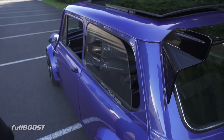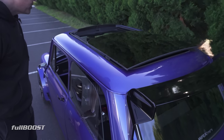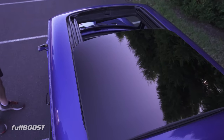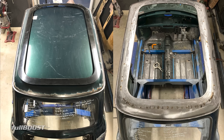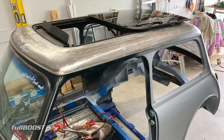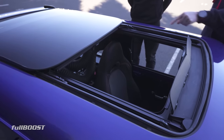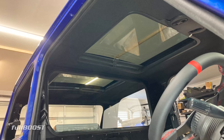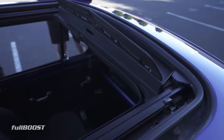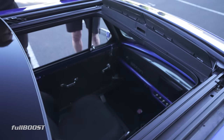The air intake sits inside the engine bay. The roof itself is out of an R53 BMW Mini. I literally cut the roof out — bought the whole roof all the way down to the A-pillars and C-pillars, pulled it out as it's all bolted in, and then welded the BMW Mini roof into this one. It's about an inch and a half gap, butt-joined and welded in, with brackets underneath for strength. That was all part of the engineering testing as well. The whole build took about two and a half years.